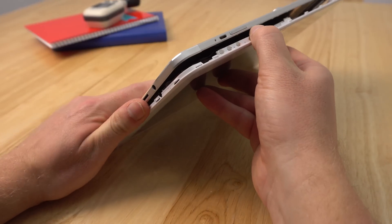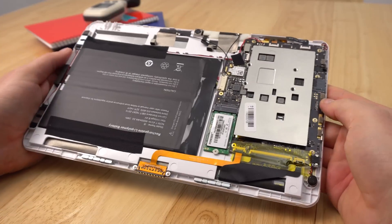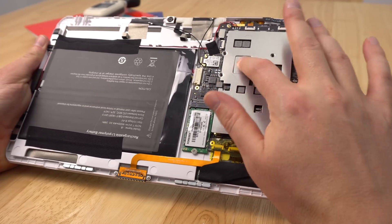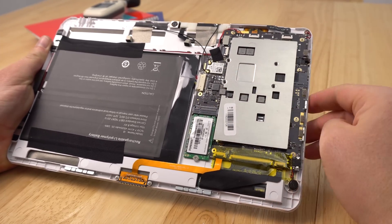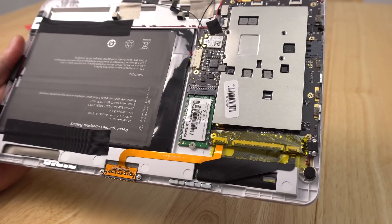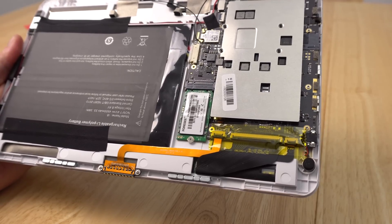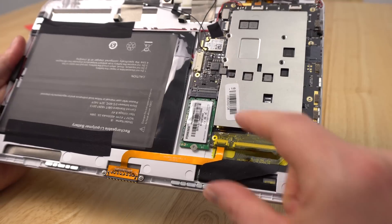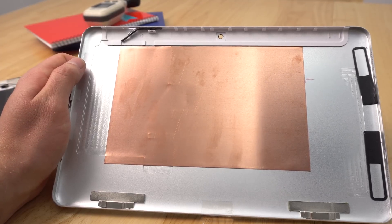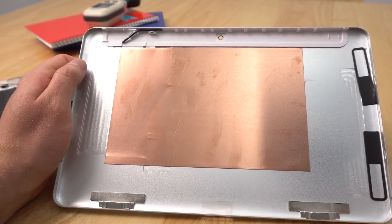You can proceed to push this part down and remove the whole back plate. We have an aluminium heat spreader right here on top of the Core M3. We'll have to take all four screws off and remove this plate to repaste or add copper. If you want to replace the SSD, now's the time — it needs to be SATA 3 spec, M.2 2242 size, up to 512 gigabytes capacity. Cube have increased the size of the thin copper on the back just to help keep temperatures under control.